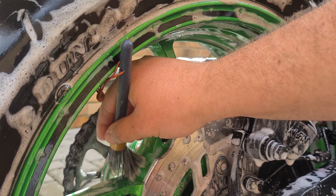Once you've done your wheels, you move on to a pre-wash. First I'm spraying on a TFR over all the engine components — anything that's cool and has a lot of dirt on it — and then topping it with a snow foam for extra dwell time. The snow foam I'm using is Mule Deep Snow Foam in the IK sprayer — a really good, thick snow foam with a good dwell time. You can see the dirt dripping off the bike. Let that dwell for about five to ten minutes and then rinse off. That's your pre-wash done.